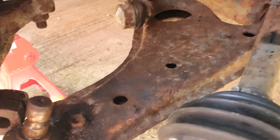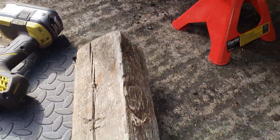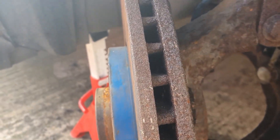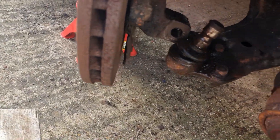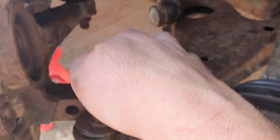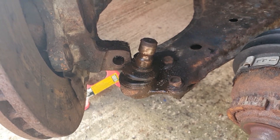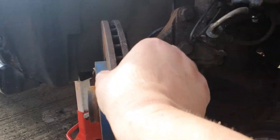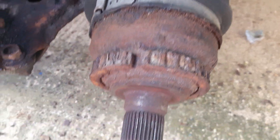That took some doing. I ended up having to belt this with a soft-face hammer and get the jack under here. I've got the trolley jack with a large piece of wood wedged up under there, and I had to jack it up as high as it could go until it was just starting to lift off the axle stands. Then a lot of levering, a bit of chiseling to open up that split in the shackle, quite a lot of penetrating fluid because it was stuck in there quite tight, but eventually it popped out. I put the steering on opposite lock to give me as much play as possible, took the nut right off the end, yanked it off — and there you can see the culprit, the thing we're trying to change.